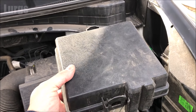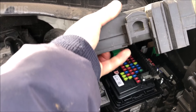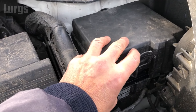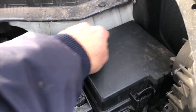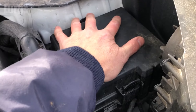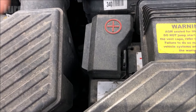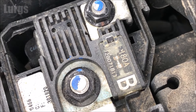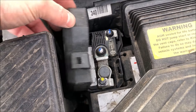To put the cover back on, make sure you put it in the right way round, gently squeeze it into that gap, push it down, and you'll just hear it clip into place. There is also a heavy-duty fuse on the battery positive terminal — just lift this cover here and that is where the heavy-duty fuse is. If you've got major electrical faults, it's definitely worth checking that one as well, but it's very unlikely to actually blow.